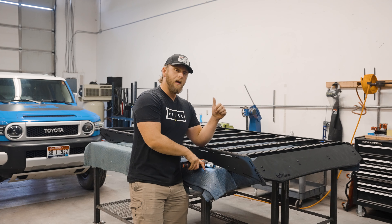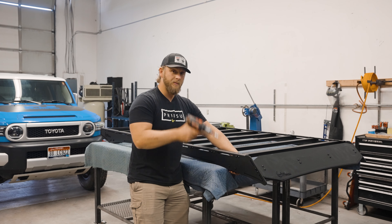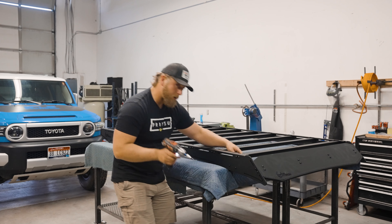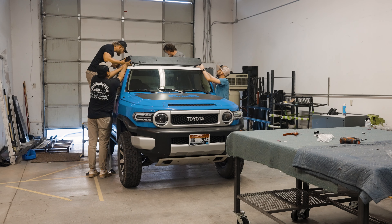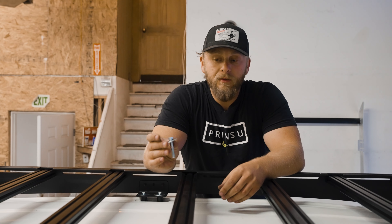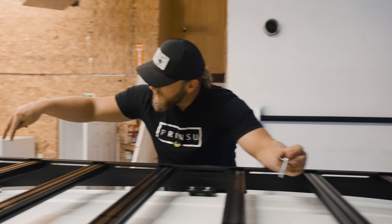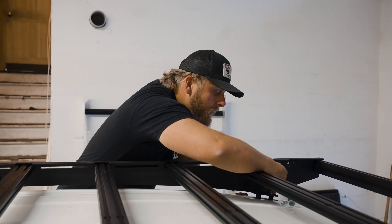Now that we're getting ready to actually lift the roof rack onto the vehicle, what we're going to want to do with these mounting feet — before we tighten them up — is slide them into their utmost position, that way it sits on the roof rack nice and even. We're going to do that with all of them all the way around the rack. As for the actual hardware to fasten the roof rack down, these are going to be M8 by 50 millimeter bolts. You're going to have a nice big fender washer, and you'll have enough in your kit to tighten down all the mounting feet. Once you get it set on the roof, just start installing them as needed.